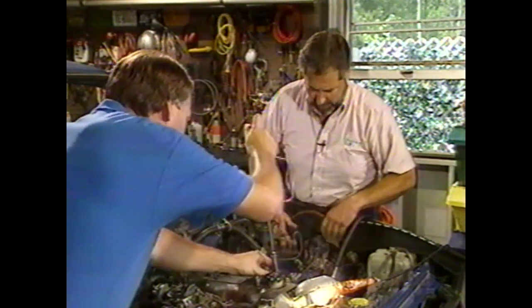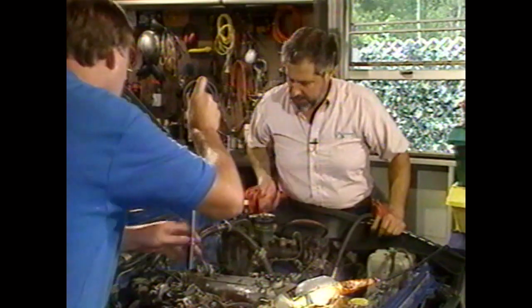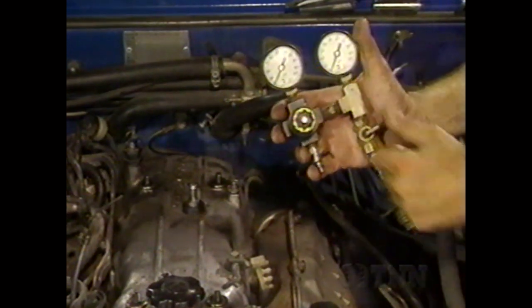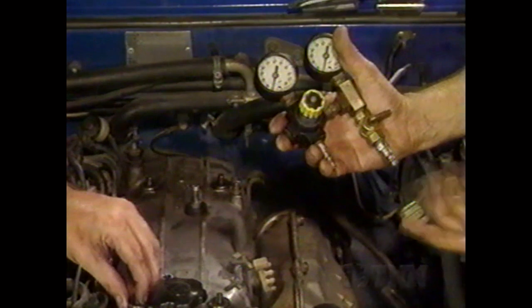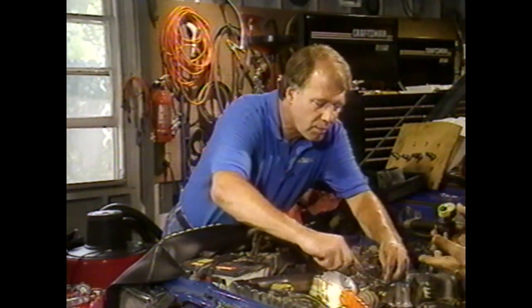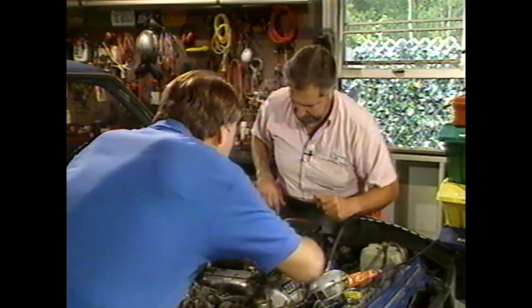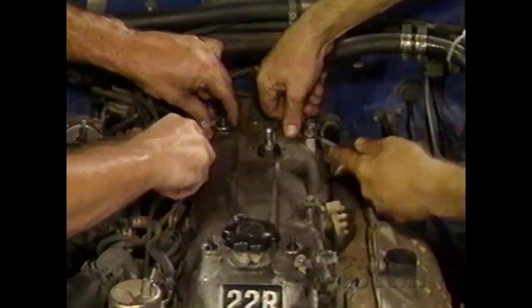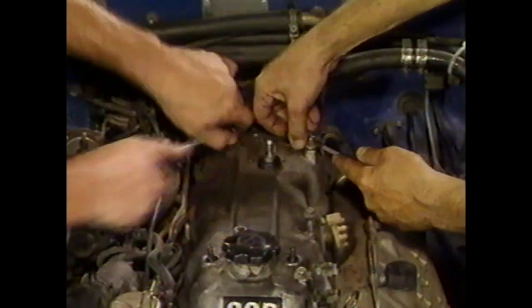This engine has some wear, so if you have a worn valve guide — which you normally have a little bit of wear — putting on new seals on the car will actually slow the oil consumption down quite a bit. If you don't have a cylinder leakage gauge or tester, you need to build one or buy one. To build it yourself you need two pressure gauges, a couple of T's, a regulator, and a valve — most of that's regular brass hardware off the shelf. If you have a compressor, hook right up; if not, you can rent one or use a portable air tank.